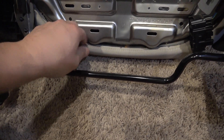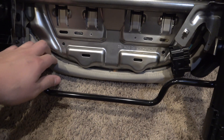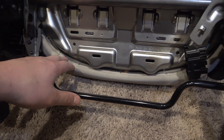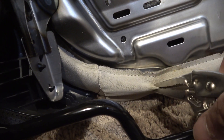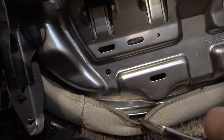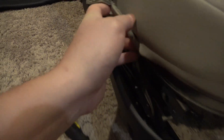To remove the seat cover from the lower part, there are little plastic pieces that connect around the seat cover — pull those off and the seat cushion cover will come right off. Then you begin cutting all the metal clips to remove the cloth from the seat. Use needle nose pliers to pull the plastic lip away from the seat, work it off, and remove a screw hidden underneath.